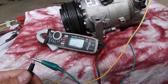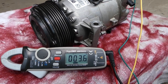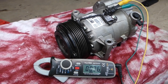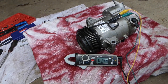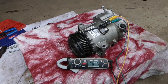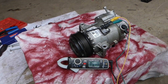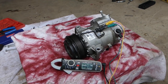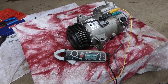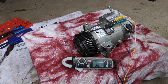We're reading 3.6 ohms. A good coil should give you anywhere between 3 and 5 ohms — if your coil is working it will be in that range. Anything outside that most likely means a bad coil, though if it's close to 3 or 5 it's probably still working. If the coil is burned, it will show no reading, like an open circuit. Hopefully this video is helpful — thank you for watching and see you next time.